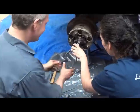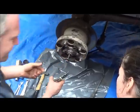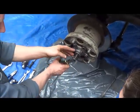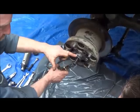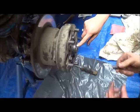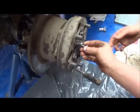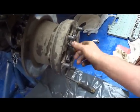So when you put it in, you find a groove. So you have the circlip open, and you put it over. And when you get to the point of the groove, which is onto there, you let go. This one, we can now take out, because you've got to fit the clip in before you take that out. Because that gives you your tension. Wind him in.